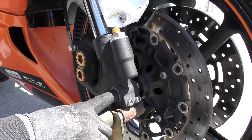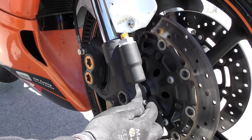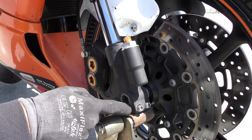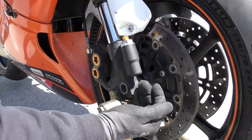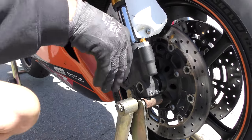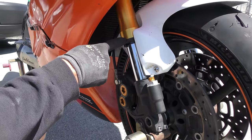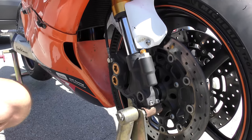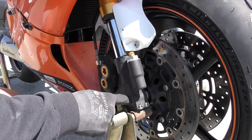Because the axle goes through this side, there's no bolt here holding this foot captive against the spacer — so this is the free leg. When we bounce this up and down, this leg on the axle has the ability to move and straighten itself out. If you don't bounce the front end, the leg can be bent, causing the fork to bind and creating brake chatter and other issues. So it's really important that you bounce the front end several times to allow the fork leg to find the straight spot on the axle.